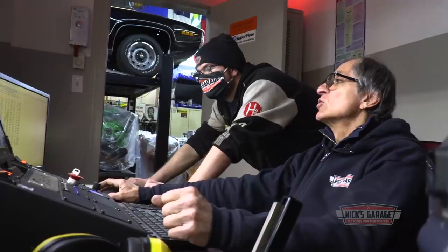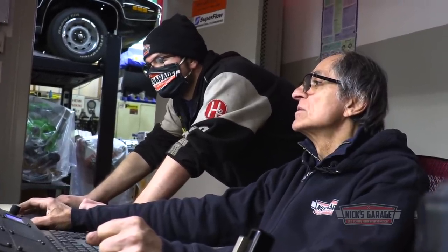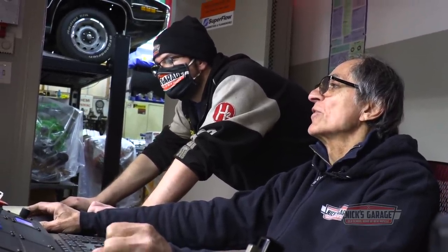Okay, let's take a look. Don't forget, I just made a test just to heat soak the block. Here we go. It's the oil pressure I'm concerned about. 88 pounds is quite a bit. We started at 2,800 RPM and finished up at 54. Temperature took off at 160 Fahrenheit. Okay, there we have it.